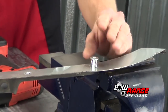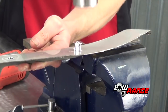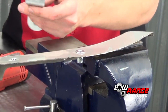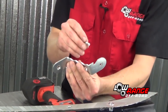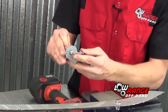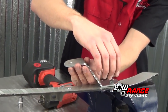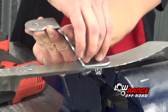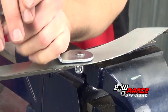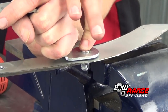You just gently set it in place and then you will have to tap it in with a hammer. Once you have it installed into the sheet metal you are then going to grab your jack nut tool and run your screw through it. The first time you run your screw through you may have to use your impact drill to get it. Go ahead and set it down flush with the jack nut, then screw down the screw — the purpose of the tool is to hold it tight so that way it doesn't spin.